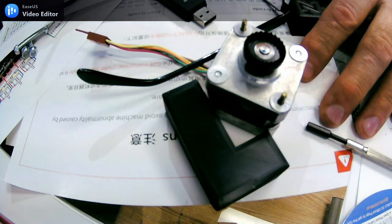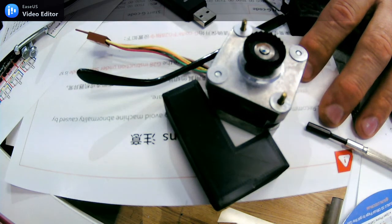What it seemed to imply was that the Creality board cannot handle the 5-volt signal that comes in from the USB line. And so if you isolate the 5-volt feed, which is a red wire, and just clip it from the USB connection from your OctoPrint Raspberry Pi to the Creality printer, you solve that problem. So I did that and it worked right away.